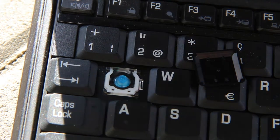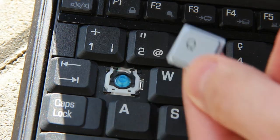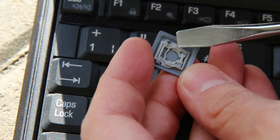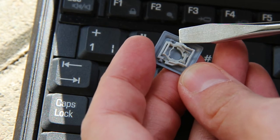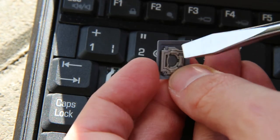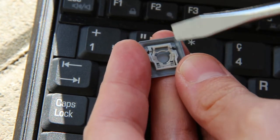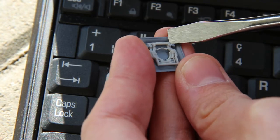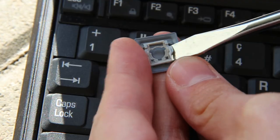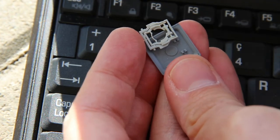Let me grab this key so you can take a look at it. If you look very closely, there are two main hinges holding this mechanism onto the key itself — one right there and one right there. I'm going to get the screwdriver underneath the corner. I'll try to get the screwdriver under this side and give it a little bit of torque. The front popped, so I'll stick it under a bit more — and the whole thing just popped out real easy.